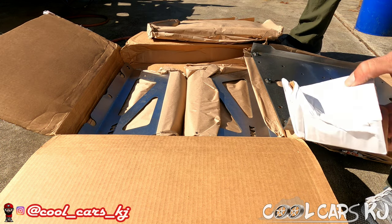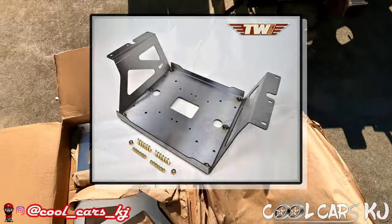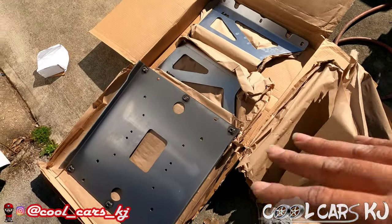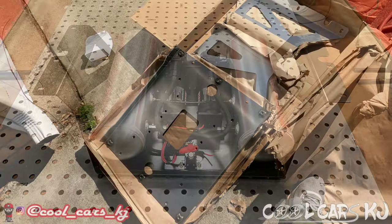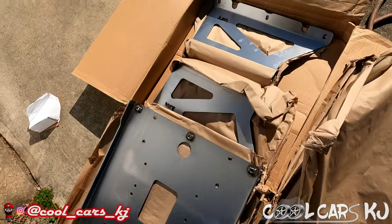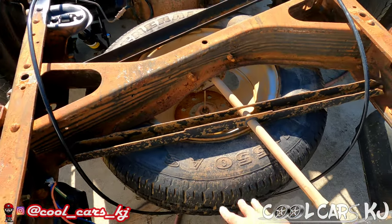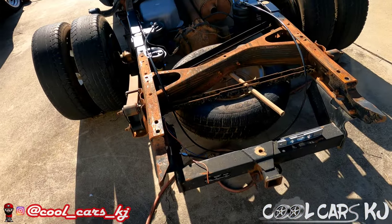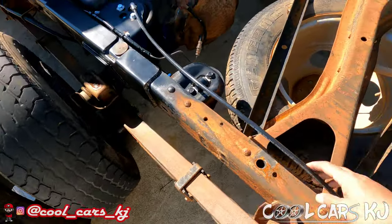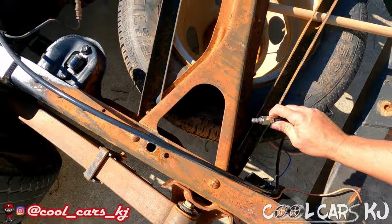I think I showed a screenshot before when I talked with them about ordering it. Basically this is a bracket for air compressors for the airbags - you can fit two air tanks and a compressor, or possibly any other brand. It's basically like a cradle that comes down and I think it goes right where the spare tire goes. I need to double check - I wanted to get it powder coated, probably flat black. That way I can have air to these bags and not have to manually air it up at the back.